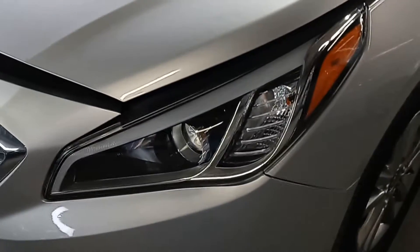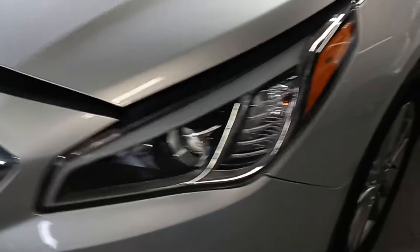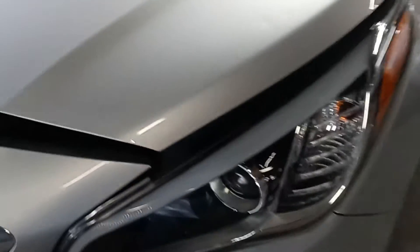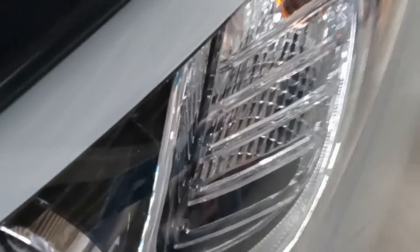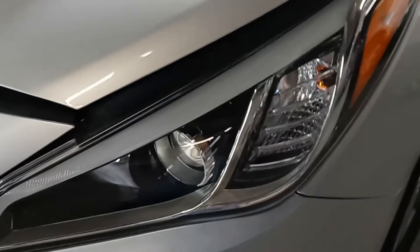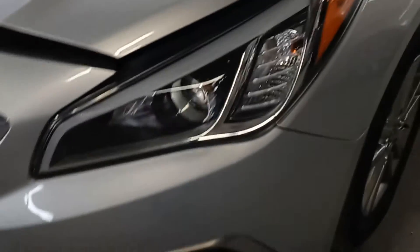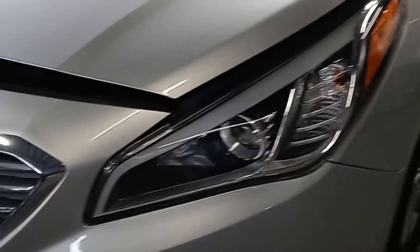I actually ordered one of each, and the new correct one is coming. I've already tested it off the old light and confirmed that is the difference. So if you have that problem where the middle light is not working and not getting power, that's the reason — you have to order the correct headlight. Junkyards won't know the difference; they'll just give you a light based on the model. That's your solution. Thanks for watching.